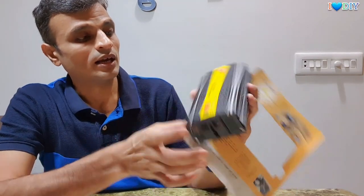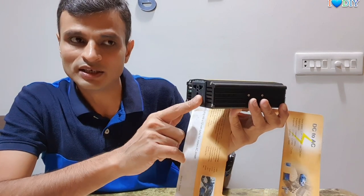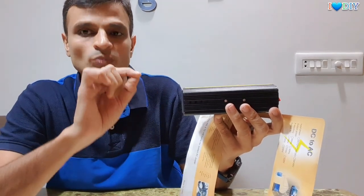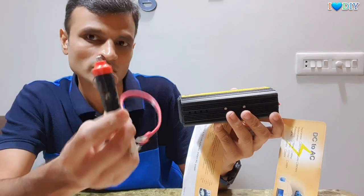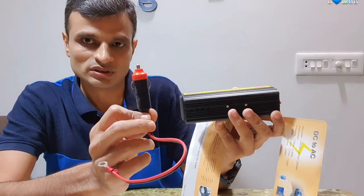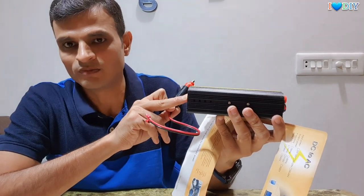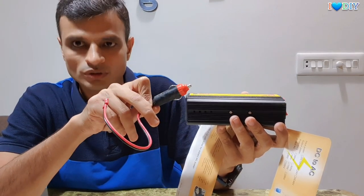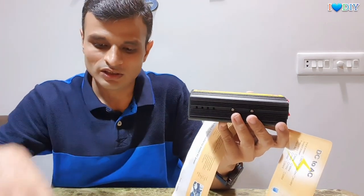This gives 1000W output. You can attach one plug here or use an extension board to attach multiple things, but make sure your engine is running — that is the most important thing. I do not recommend using the auxiliary port accessories provided, because those auxiliary ports come through a fuse first, and your fuse will not be able to tolerate this load. Also, all those connections are directed through the ECU, so the load will be on the ECU. Do not take that chance.